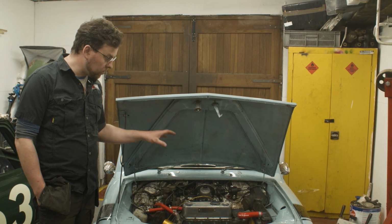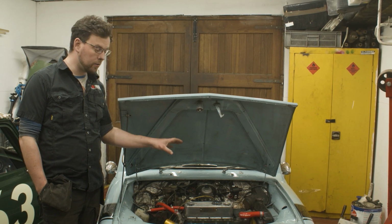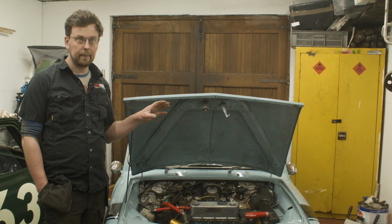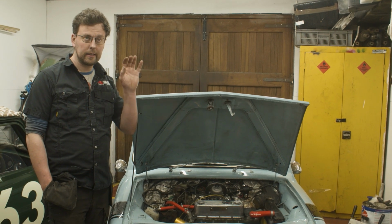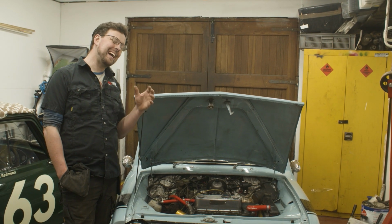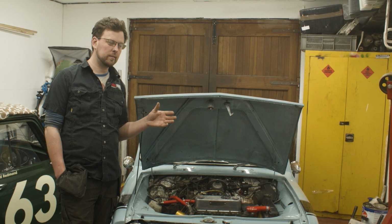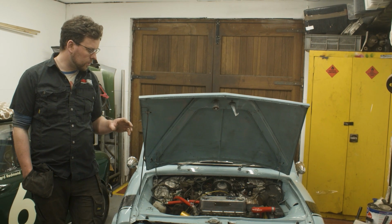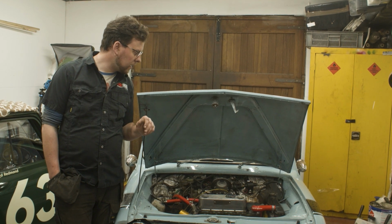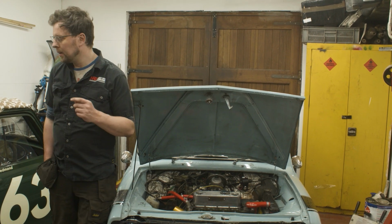It actually pulls really well and runs really great, other than at slow speed and part throttle acceleration. The needle profile is just not exactly where it wants to be, and it can foul the plugs in traffic and ticking over and stuff, and cold running. So we'll get that sorted, and then that little car will be a dinger to go.